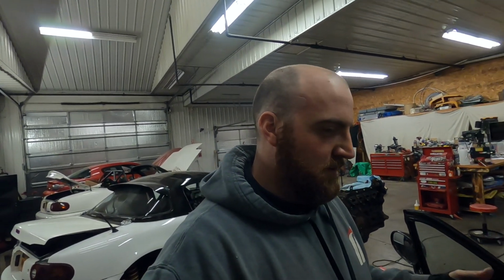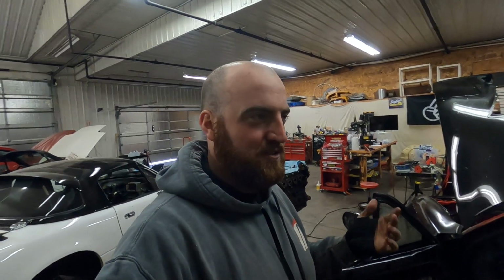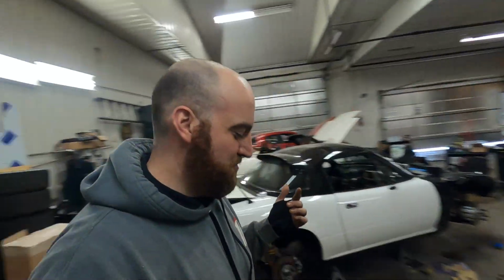I was at my wit's end, and then I sent Jesse a video. Big shout out to Jesse from Beer Money Motorsports. I sent him a video and he's like, why is it reading 19 volts? Because standard Miata voltage is like 14, I think. 14 to 15 volts is kind of standard. So it turns out the problem the whole time was up here.